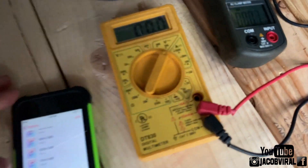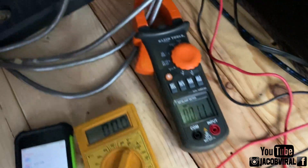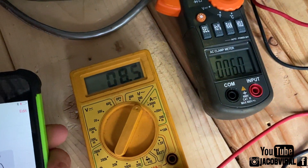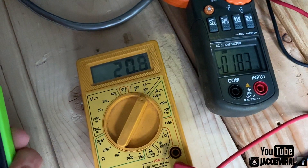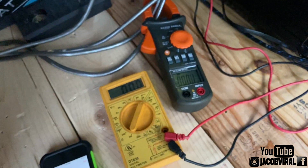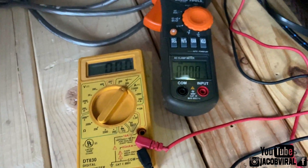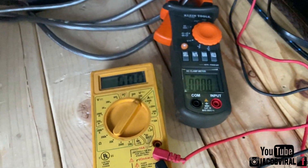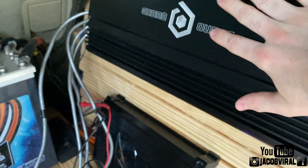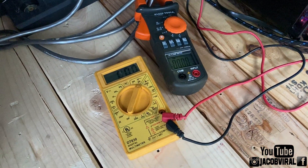Now I'm going to go more towards where I peak, around 53 Hz. Turning it up — that was 28 and 24. So 28 times 24 is around 700 to 800 watts going to this subwoofer. That's true wattage, non-clipping. It gets to a point where your subwoofer doesn't like the power — it depends on the enclosure for how your output is.